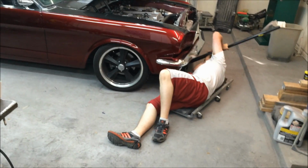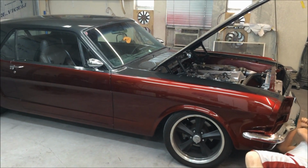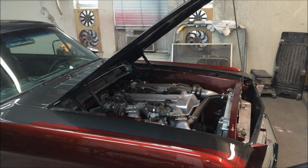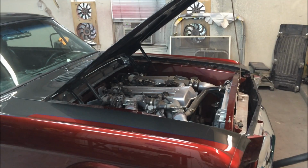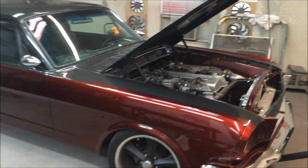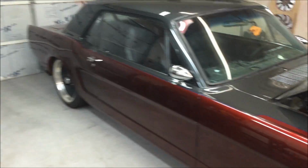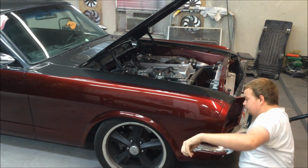All right, well, as you saw on the dyno there, the car made 284 horsepower to the wheels. This thing, being the Japanese import version of this engine, was rated at 280 at the flywheel from the factory, so it's a pretty good number. What you didn't see there was that the thing is just running super rich and not having any real tuning ability on it. We have the fuel pressure regulator set a little bit high, just to make sure we had a conservative tune. Don't want to be blowing up any gaskets or anything on this thing.